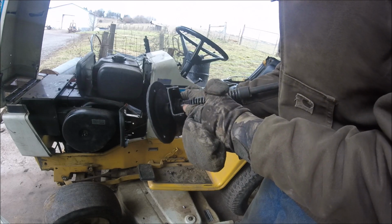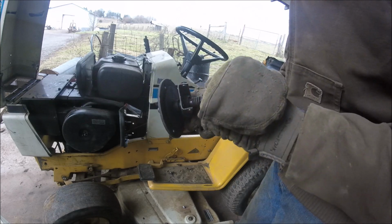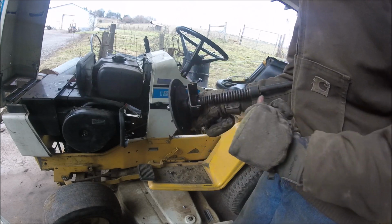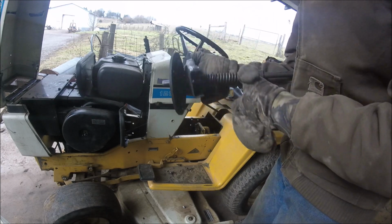The end of the spring got hot. When springs get hot, they collapse. They don't have any more tension, and that's what happened here. So like an inch and a half, 2 inches of the spring is smashed down and collapsed.